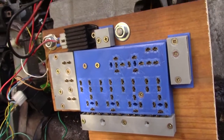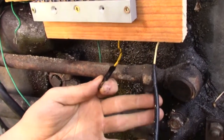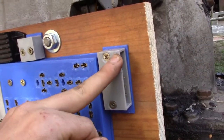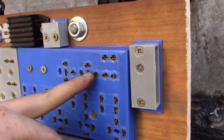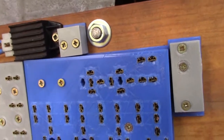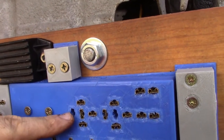Now we will wire this up with the exterior. These are the main power supply commands. We've got the Neiman with two wires — one yellow and one white. The yellow one will be connected to the plus 12V, and the white one will come right here. This will turn on both relays when you turn on the contact. The first relay will turn on everything below, and it will be connected to the permanent plus. The second relay will turn off the ignition by connecting the CDI wire to the negative when the contact is off, and it disconnects when you turn the contact on.